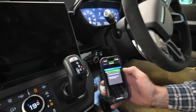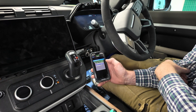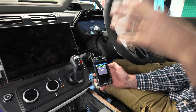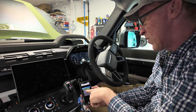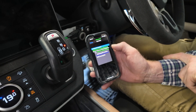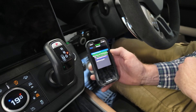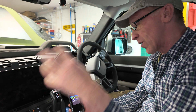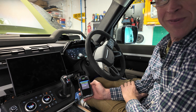We're all back to life — but no Pivi screen. Maybe we have to ignition-cycle it. I've had it before where you have to power it down because something's gone down. Switching ignition off because I think it has to program it and then power it back up again. We still have no screen. It's doing some IDNA learning now — it's learning the SODL as well. Maybe it's reflashing all the modules, or the CCF has to populate to all the modules.